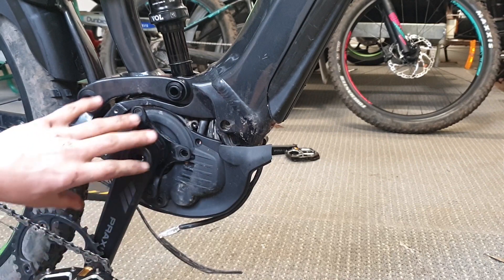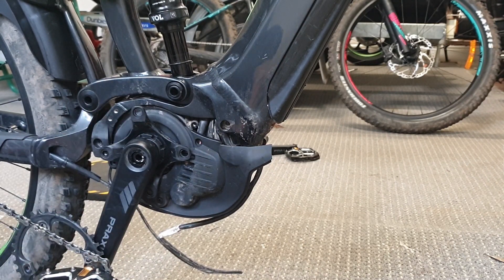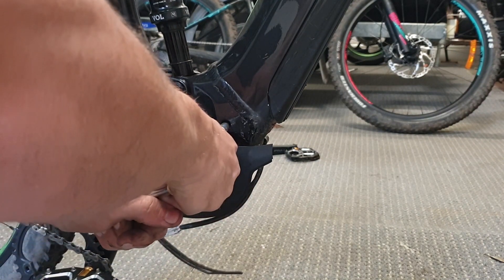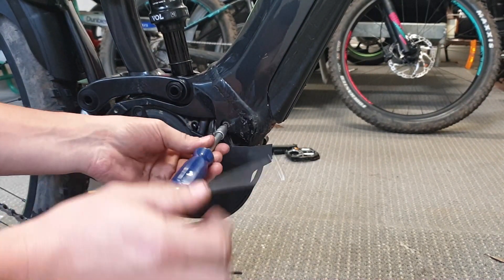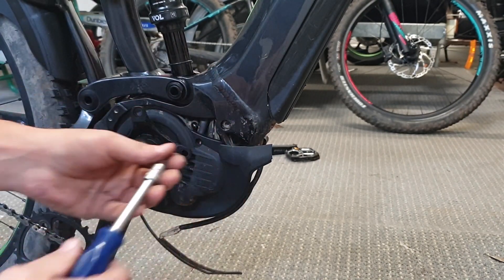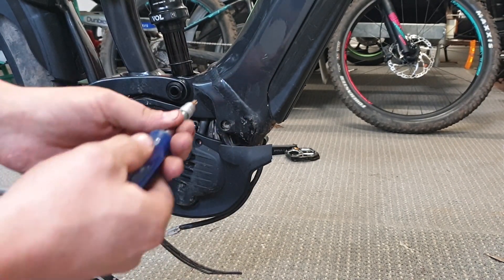Now that's out of the way, there are three Allen key bolts on this cover. Thankfully this cover's dropped and we can access that bolt without taking off any of this here. Now we're going to go to this front engine bolt — you want to be careful on these, they're very tight, you don't want to slip and burr your hex nuts.